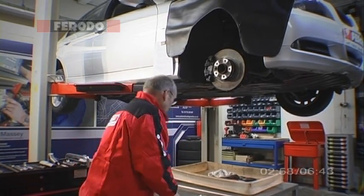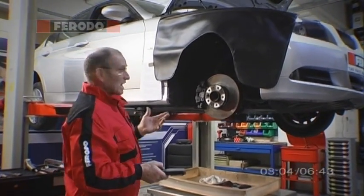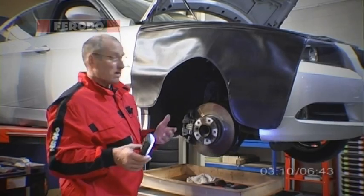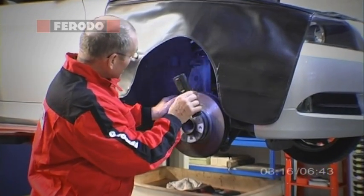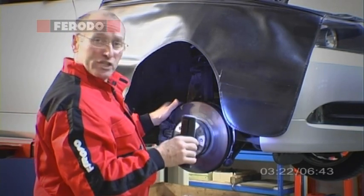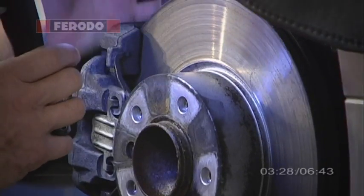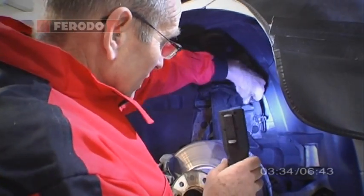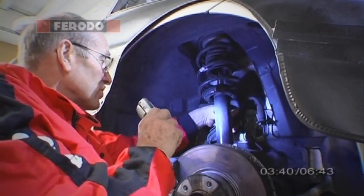And if you kindly just let the vehicle down a little. I'm going to take the opportunity — this is still part of pre-inspection; we've not actually started the dismantling procedure with regard to repair or service. Because we've steam cleaned this vehicle, under here now is pretty clean, and it's fairly easy for me to have a look to see if there's any collision damage, mechanical damage, hydraulic flexi hoses, etc. So I'm quite literally going to give these flexi hoses a real vigorous flex and move — I want to see if there's any signs of cracking or any signs of chafing.